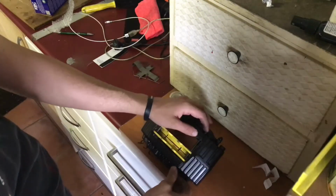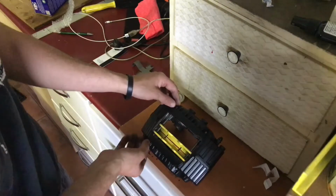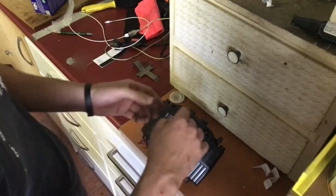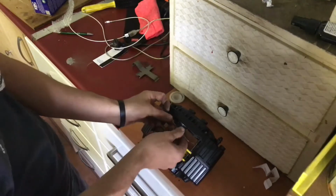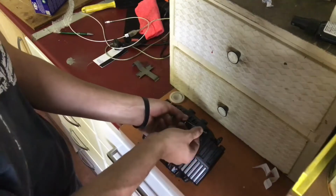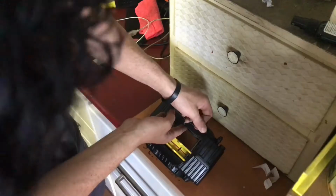Now once you push these through on these Nissan brakes, there's 2 little pinholes on the top of these lock-in pins. You've got to make sure they're facing up, because we need to put this lock-in bar in next. What that does is we need to slide this into a hole on this side, and if anyone knows an easier way or a better way, I just slide it in like that, and then once we slide that in, put it in those 2 holes.